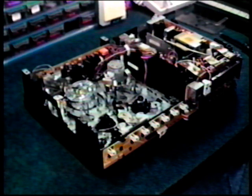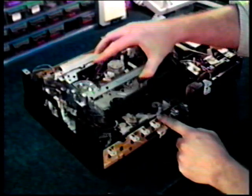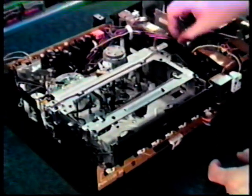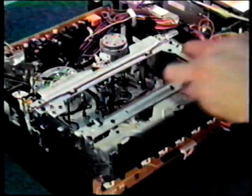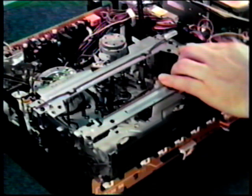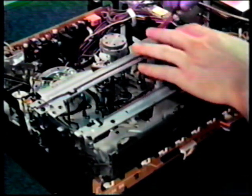After you have completely rechecked the cassette housing for proper reassembly, it's time to replace it. Notice the two tabs pointed out here, 1 and 2. These two must be securely seated before replacing the two screws. Failure to do this procedure will result in improper operation of the VCR. After the two screws are in, replace the electrical connector.